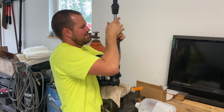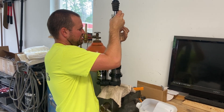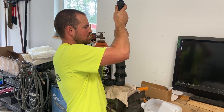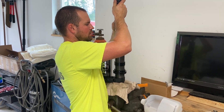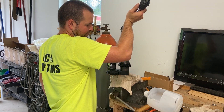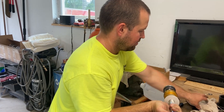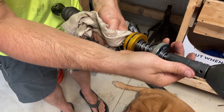That allows you to pull out the entire piston shaft and valving out of the top of the shock body, and you can do this without losing any oil or needing to replace any oil. Once you pull the shock shaft out, it's pretty similar to other ones we've seen — the only ones we've rebuilt before are King shocks. There's a spring in this one and the piston is a slightly different design compared to the King shocks. There's just a locking nut holding on the piston and the shim stack at the top.